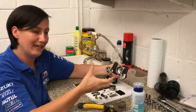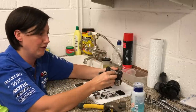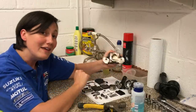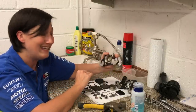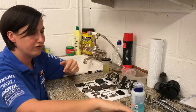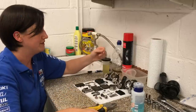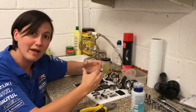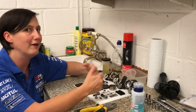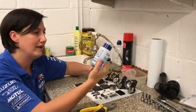By putting the caliper back together again I was able to use the hydraulic pressure to push this piston out of one side of the caliper. This side, however, isn't budging even a little bit. So what have I tried? I've tried the typical approach with a rag, pliers, mole grips, sticking it in a vice to try to pull it up nice and straight. I tried reassembling the caliper and using the hydraulic pressure to pump it out - that was having none of it.